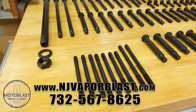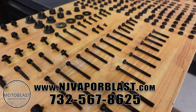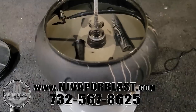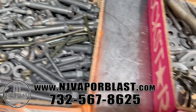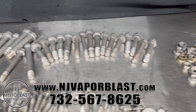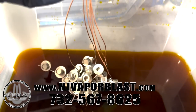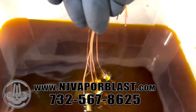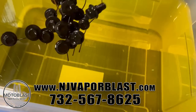Just look at this work — he did a great job. I wish I had taken some videos when these were all dirty and rusty, because I had put these in the tumbler and cleaned them up a bit. The before and after is still pretty drastic. You can see they're bare; there are a couple rusty and dirty ones in there. But James literally vapor blasts each individual bolt, which takes a ton of time. Then he hangs them on wire and dunks them in an electroplating tank. He can do black zinc, blue zinc — which is like a silver look — and then the traditional yellow zinc.